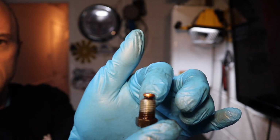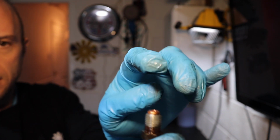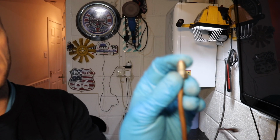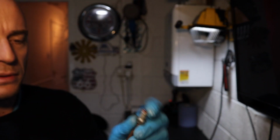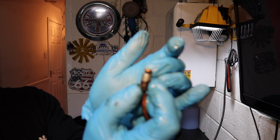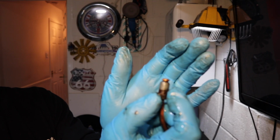It should have a shoulder on it, which means this flange of the nut will touch the body of the T-piece or the bit for the front wheel before that gets bottomed out and compressed. The other end was okay, that's been compressed. Won't focus on it, but that end hasn't. So the unions that I should get are the same thread as this, but they have a little shoulder on there which allows it to screw in and press the copper tightly into the fitting so that it seals.